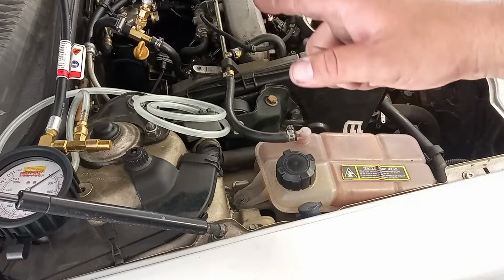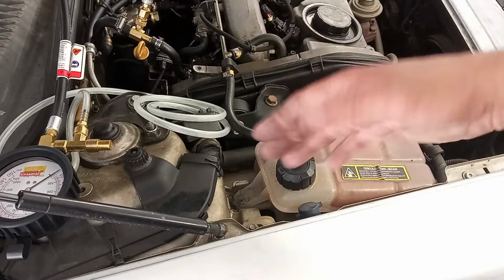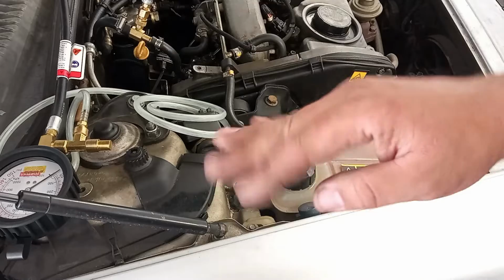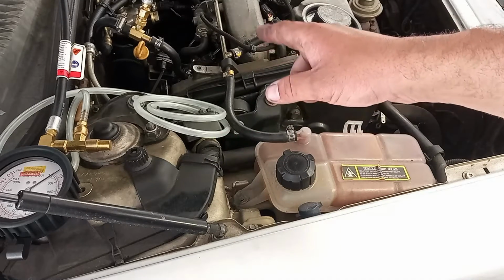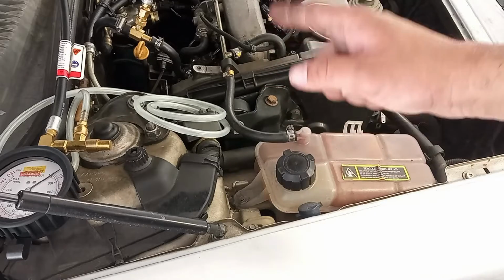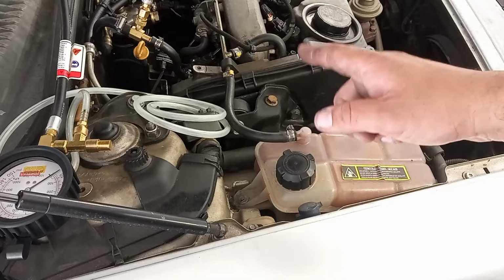So possibly I will not be able to do all the way the verification of the pressure on the diagnosis machine because it is too slow to see the variations of the high pressure fuel pump. I would remove the high pressure fuel pump to the specialist. He will confirm or not the issue and repair it accordingly, okay?